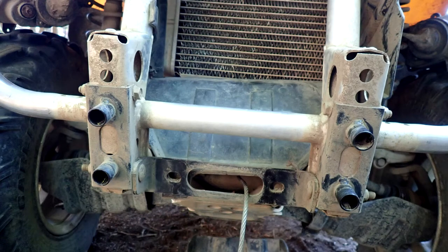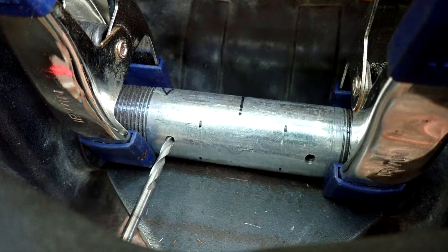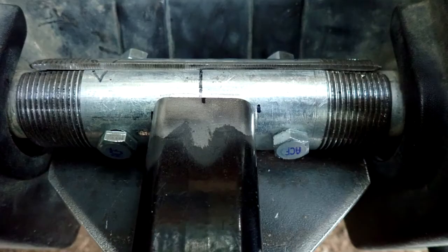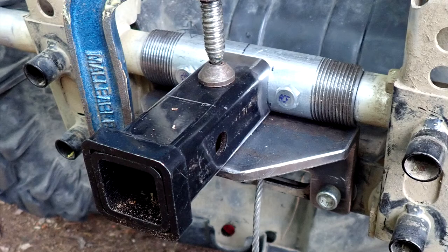Here's what the ATV looks like without all the bumpers and plastic attached. To get started I clamped the two pipe halves around the aluminum frame and positioned it where I wanted it so I could drill the holes all the way through to the back. Here's a better picture showing the setup with the pilot holes drilled completely through both the steel pipe and the aluminum frame. You can see I've made the pilot holes big enough for the bolts and I'm getting things lined up, ready to tack weld the receiver on.